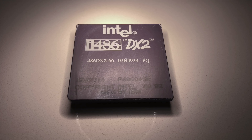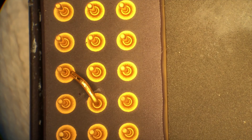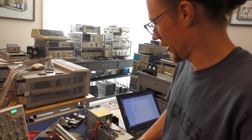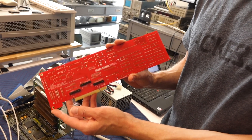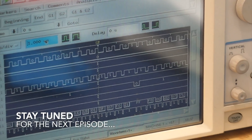So it likely is not a processor problem either, admitting we did not get a fake or broken replacement. In hindsight, we checked that the bent pin was a VCC pin, of which there are plenty — so it is probable that even with a bent pin, the original processor would still have been functioning. That's it for the easy debugging. Looks like we need to call in the cavalry — that would be Eric, or TubeTime as he's known on Twitter, who specializes in PCs and knows quite a bit about the microchannel architecture. Expect heavy artillery debugging in the next episode. See you then!